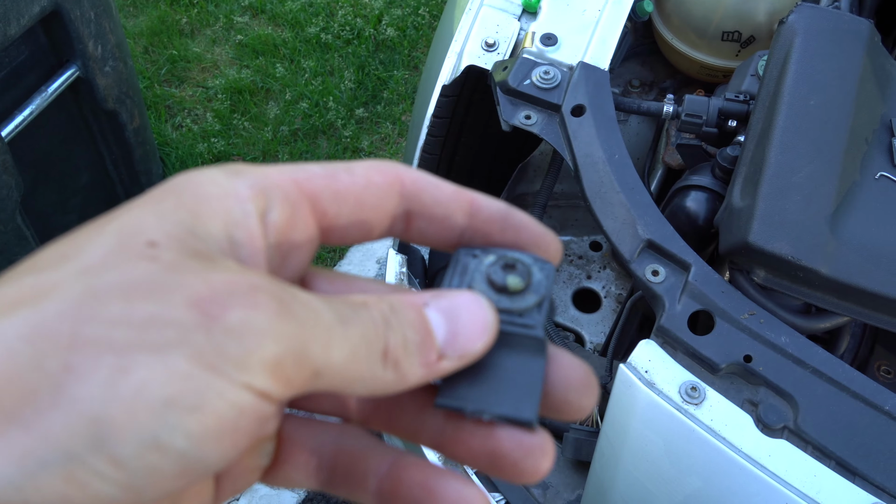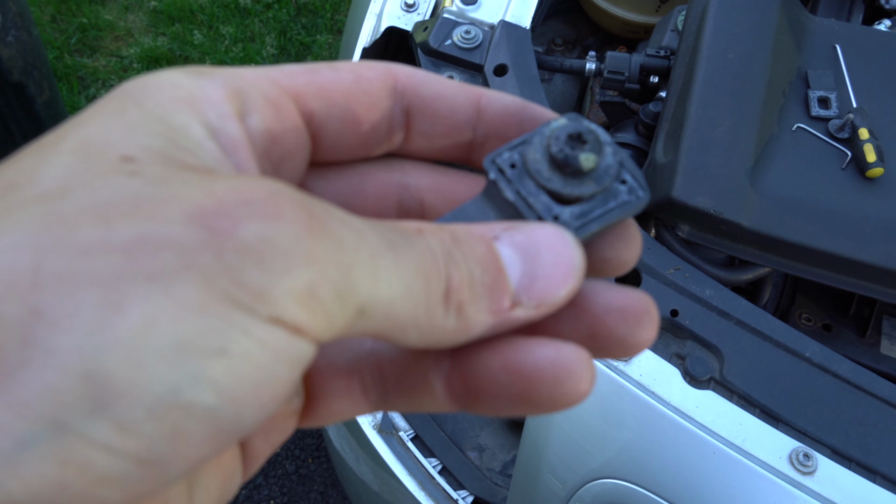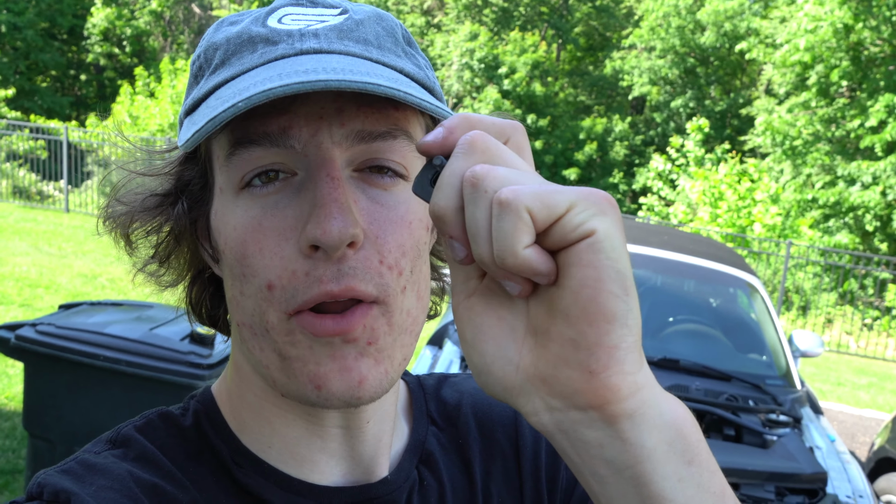Also, one of the things I've noted is that there's actually a really big hole in here, so this nut is able to free flow, and once it gets tight enough, it kind of does all the adjustments. So I don't have to get the spot on key with a little hole and hope for the best. So I could drill one big pilot hole in this piece right here, and we'll fit up really easily. We have a lot of adjustments. So yeah, let's go ahead and make these things.